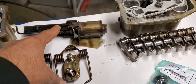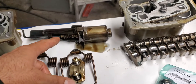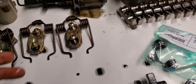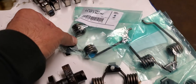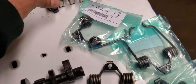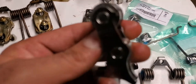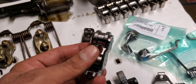I'm also going to replace the Valvetronic motor because these motors get weak over time. The two main problems are: they're not touching properly, and the motors go weak. If they're bad they generate individual codes for the Valvetronic motor. Since I'm already doing all this labor, I'm not taking chances. I'm also changing the springs — these are new springs from BMW. Now look at the old versus new intermediate drag rollers — can you see any difference?